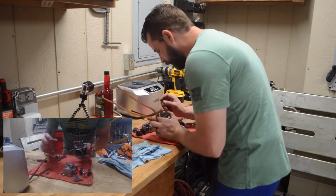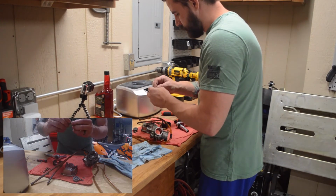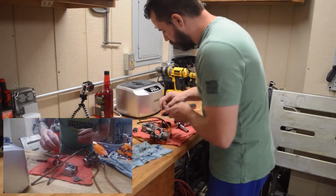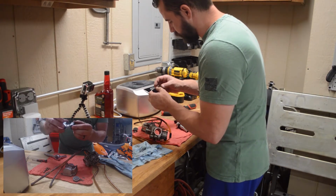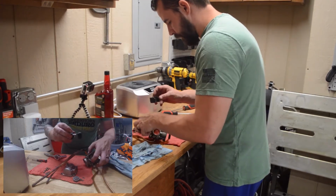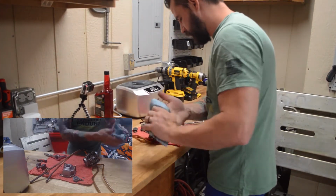Okay, there's no valve under here. Oh, no. So your float needle is this thing right here. It hangs right underneath this little guy. And as the float level increases or decreases, it closes the valve off to allow more or less gas in to fill the float, which is this little guy.